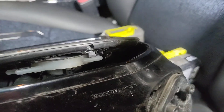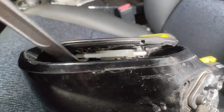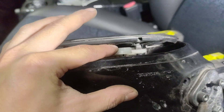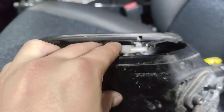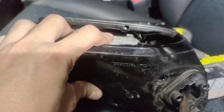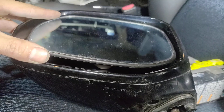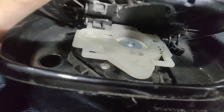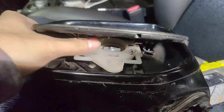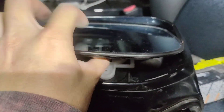The parts where it clips in at the bottom are that clip right there and that clip on that side. You're going to want to get a pick, flathead screwdriver, or a really slim panel tool like this one, and lift those two clips up. Once you do that, push the actual rotating mechanism — the white part — down so it's flat, and then lift up on the bottom of the glass.